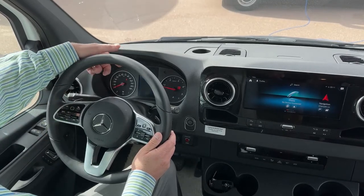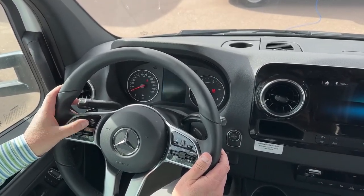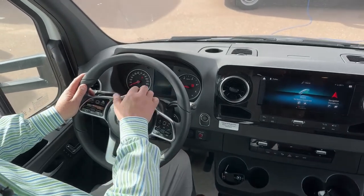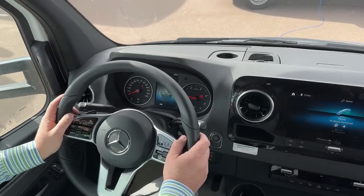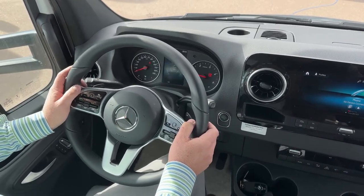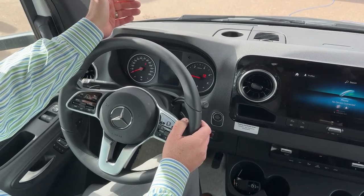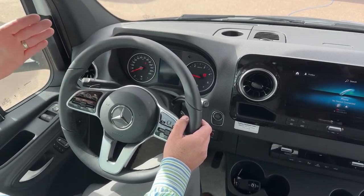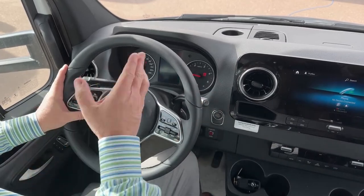Also on this side you go to the main dash and scroll through it. You have lane guidance and also lane departure warning. When you're driving down the road, this little vehicle icon turns green when it's activated, and it starts at 25 miles per hour and goes up from there. If you start to drift out of the lane, it beeps and lets you know. You can also adjust the distance between the vehicle in front of you — laser-guided cruise control. You can determine how many car lengths to alert you, and it'll automatically adjust the speed of your cruise control if someone jumps in front of you, then it'll catch back up to your regular traveling speed.